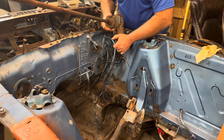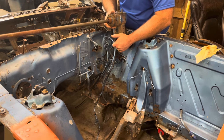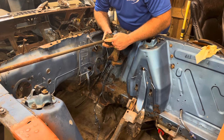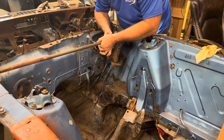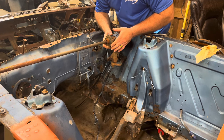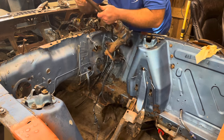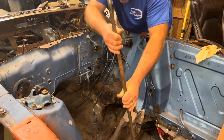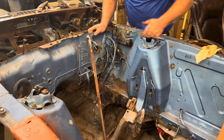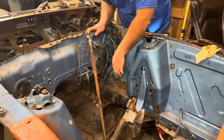Do you see that spear I was telling you about? You can't fully understand it until you've got the whole thing in your hand. That is a solid shaft. Right here is where we're going to cut the shaft and put that rag joint in, and that will go on to the new power steering gearbox we're going to put in the car. It'll be a much safer setup. Yeehoo — we're getting our panel area a little clearer so we can start doing some work.